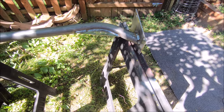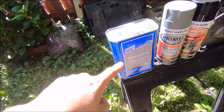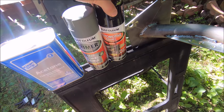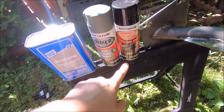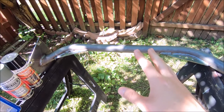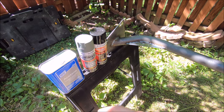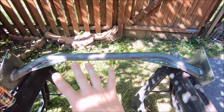Getting ready to prime and paint the crossbar. Went ahead and wiped it down with a microfiber towel and some acetone. I'm going to hit it with a few coats of self-etching primer — I love this stuff, it's fantastic. Usually I go with flat black but I'm going to use gloss black — Rust-Oleum — which should give it a nice finish to make it pop just a little bit. I know it's going to be under the bed all the time but I'll still be excited about it. I'll put links for this stuff in the description below.